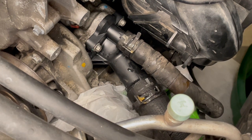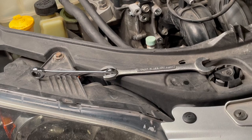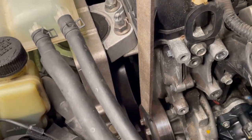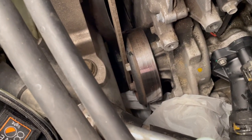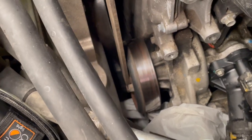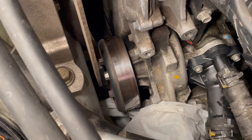We're all hooked up and ready to move on to the water pump. The difficulty with the water pump is that there is no space, but we have a way to work around that. We'll have to get a little creative to get that pulley off. I'm going to use a ratcheting combo wrench coupled with another one so it extends farther up so I can reach it. I'm also going to use a flat file — I'll slide it between two of the pulley bolts to stop the spin of the pulley when torquing. We'll loosen one bolt at a time, rotating around to each one.